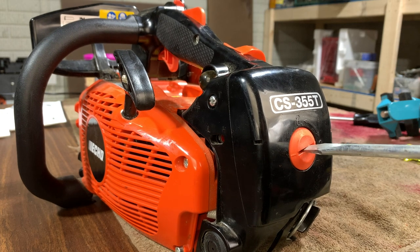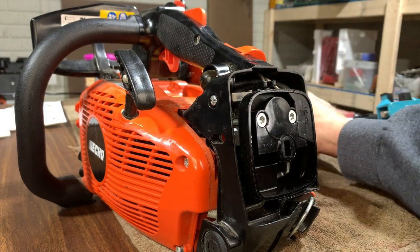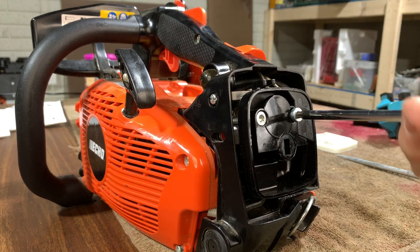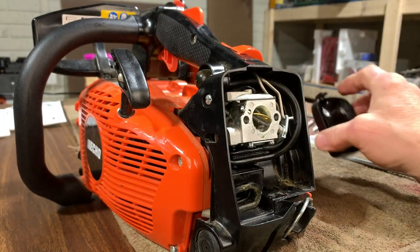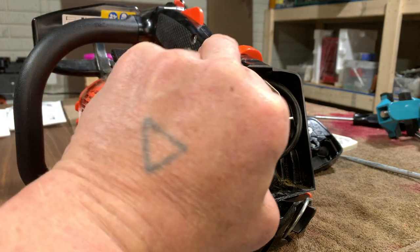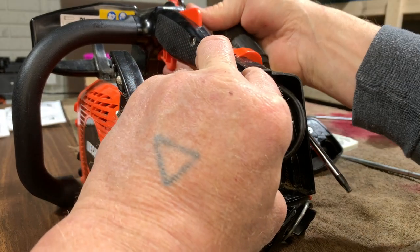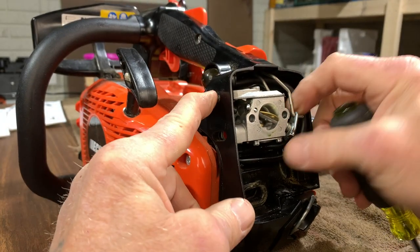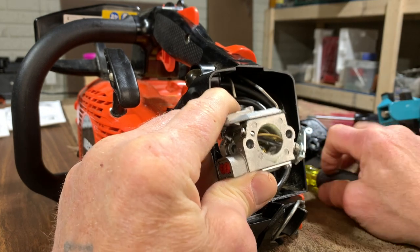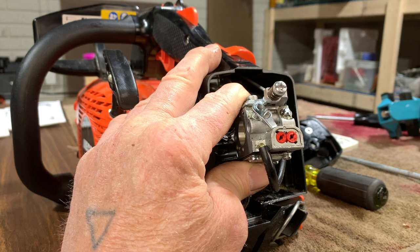But for clarity's sake - for demonstrating how these things are actually held in place and how to remove them - I'm going to go ahead and pull the carburetor. The first thing I'm going to do is pull the air cleaner off and set that aside. Then I'm going to loosen these two screws right here and pull them out. Those two bolts hold the carburetor to the intake manifold. Now I'm going to pop this rear throttle linkage off. There is an idle screw right here - you'll have to pull that out of the side - and then you can disconnect the choke linkage. I'm going to mount this in a little vice, so we'll be back in a moment.